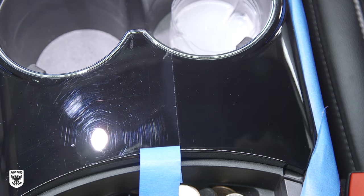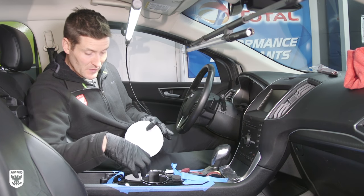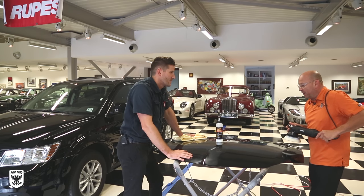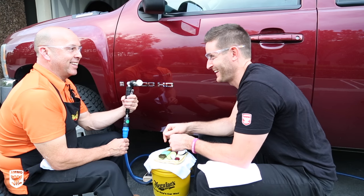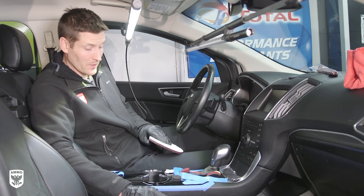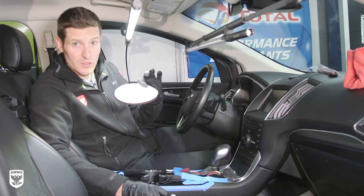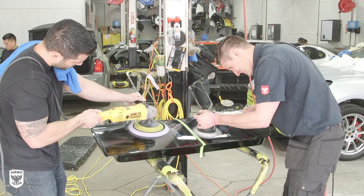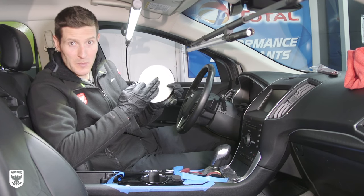After multiple short sessions with red and black pads, here's a healthy 50-50 shot. Let's break down the actual steps and discuss why this type of mini polishing is more difficult than with larger tools. I wanted to stop here for a quick conversation because this 50-50 worked out really well, but I ran into a bit of an issue. I called Kevin Brown — as we all know, completely insane and the best polisher in the world. He explained a concept I remembered but hadn't thought about. In his example, we have a 5-inch microfiber cutting pad. We do about a 2x2 area — Kevin does the math and it's 23 square inches covered by that pad.